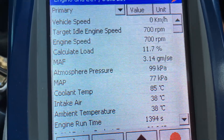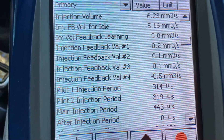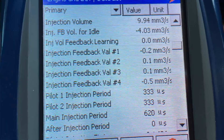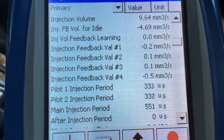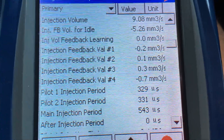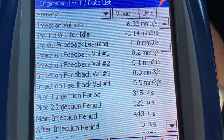Going back to the main readings page to show what happens when the aircon goes on. Switching the aircon on — you see that injection volume go up really high. That's why you need all accessories off when taking readings. If I wanted to sell you injectors, I'd just leave the aircon on. But it goes both ways — talked many people out of injectors too. Hope that video has helped. Subscribe for important information — encyclopedia Prado.